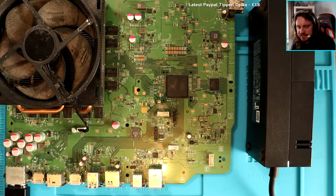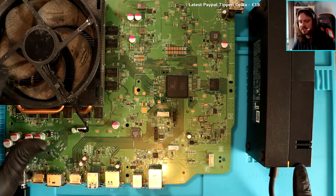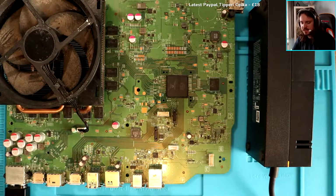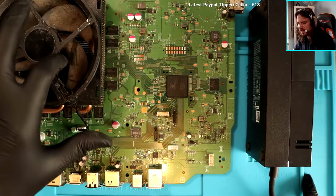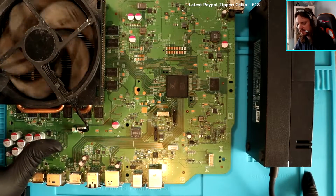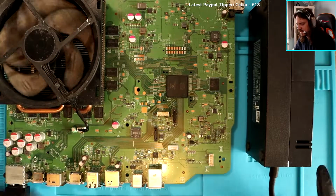Check for voltage on the fan connector. Does the fan move if you push it? No. And now you see how it's turning itself off? Flick the fan, see if it starts spinning. I'll take it out and try again. Ready? But it's just nothing's happening. See that? And it's still on.